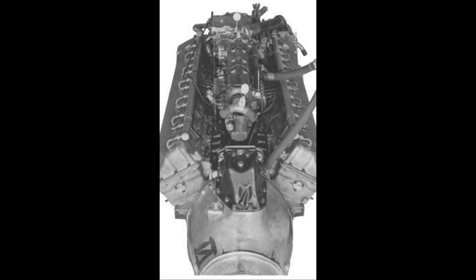The U.S. Wildcat and all subsequent U.S. Navy fighters had intercoolers. So did the P-38 and P-47 and Merlin-powered P-51. So this wasn't new, but charge coolers were not common in German fighters. So the TA-152's dual stages and aftercooler really brought it up to current standards, not really ahead of them. For example, the P-51's Merlin is configured the same way, dual stages and an aftercooler.